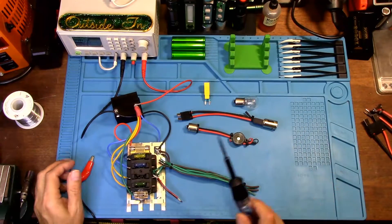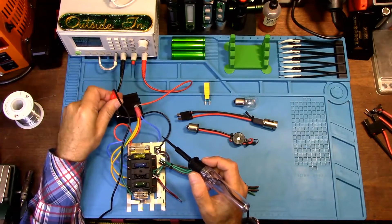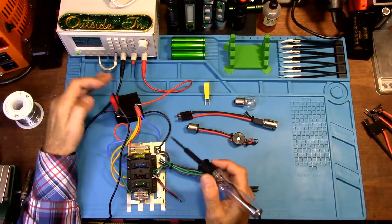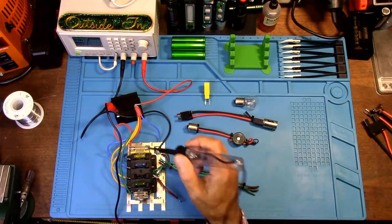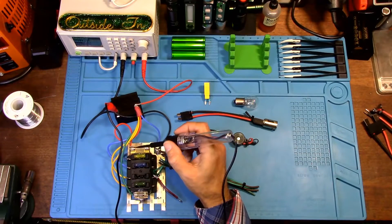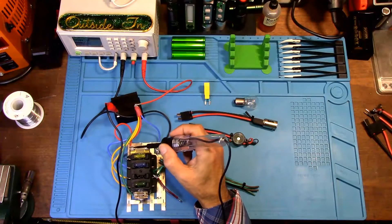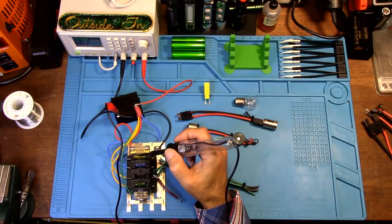Keep in mind: if you connect your ground to the battery or ground on your system and start probing and there's no voltage — no light coming on either side — that's because sometimes certain fuses are only activated once the vehicle ignition is on.